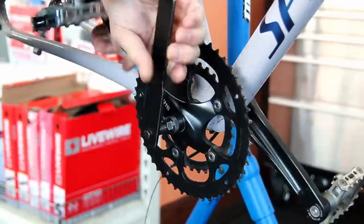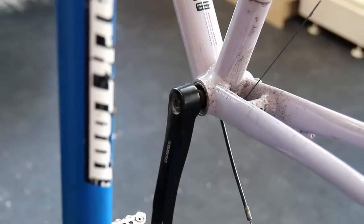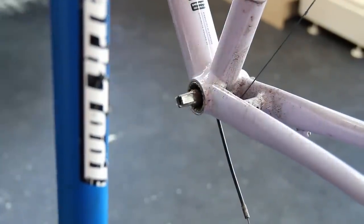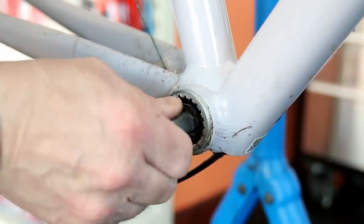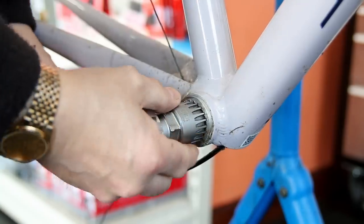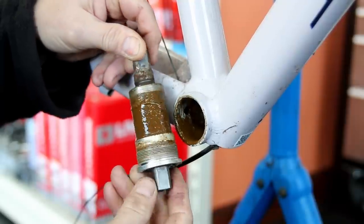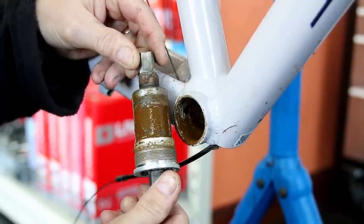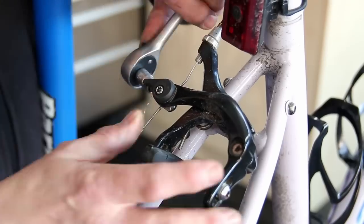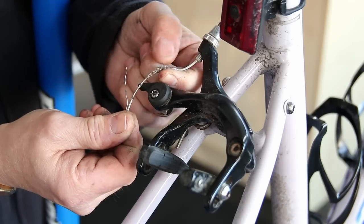Now we get the chainset off because I could feel when I spun it that the bearings were worn. You can see there's a bit of debris on the back, but I could hear the bearings were rumbling when we spun the chainset during diagnosis. You can hear how rough that bearing is - you don't need to physically see it to hear it. It was very notchy, very tight, and would have made the riding experience quite bad. Look at the water on that bottom bracket - that's what caused the bearing to fail. Water has pooled in the bottom of the frame and soaked into the bearings. Ideally the frame could have done with a drain hole, but that's really a design flaw on the part of Specialised.